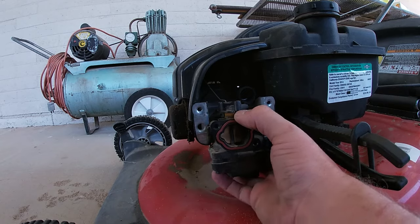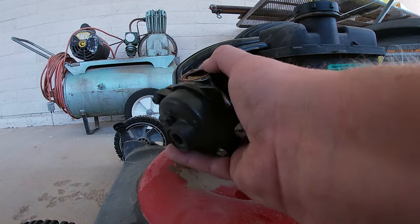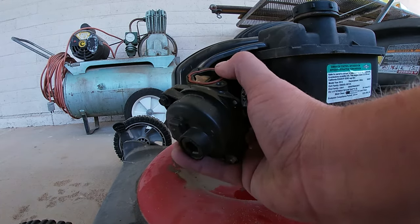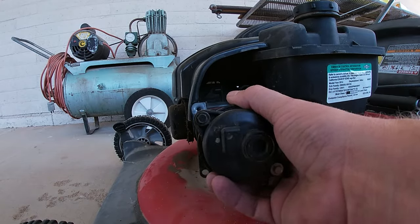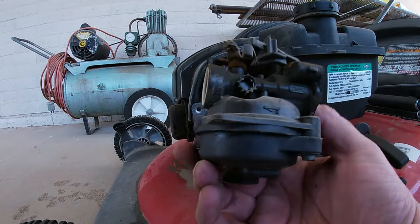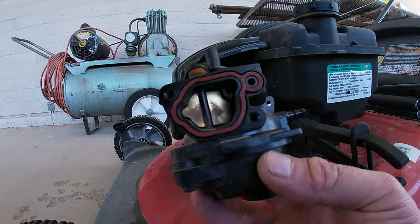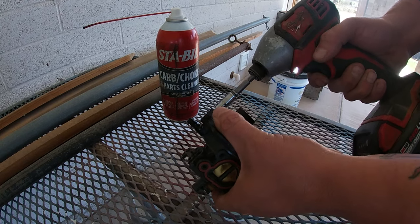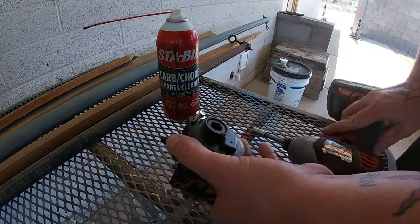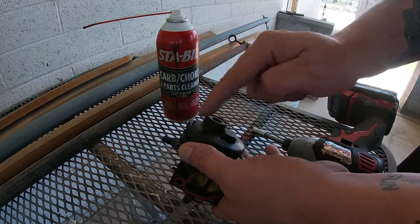All we've got to do now is twist off the throttle cable first — we'll do it in reverse when we put it back on. Throttle cable off, choke cable off — there's our carburetor. Now we can take it to the bench, clean it out, and put it back on. To remove the carb bowl, there are two 7mm bolts on the bottom. Remember this part goes to the fuel line, not the other way around, though you can accidentally put it on the other way.